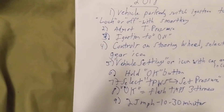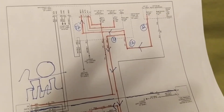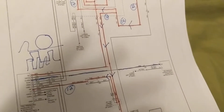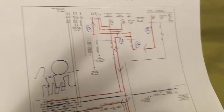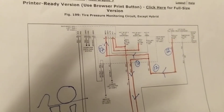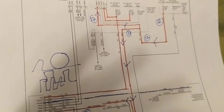Even when you change a tire or do a tire rotation, you still have to take that transmitter valve and put it in the new tire. Otherwise, the system will not recognize it — it'll give you a fault indication light for the tire monitoring system, because you left the valve in the old tire.